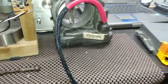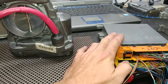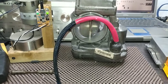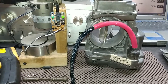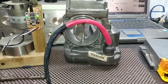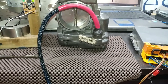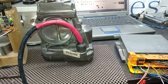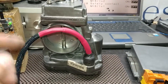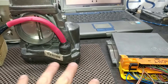Another thing: the activation of the unit is only possible halfway, because of the way the controller works. The S-class E-gas module does not let you open the throttle all the way — that is to prevent over-revving the engine on startup. Even when the throttle opens like this on startup you'd hit the red line. The throttle will open all the way when you actually drive the car and go uphill or floor the vehicle. On my bench here this is totally normal operation.